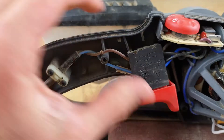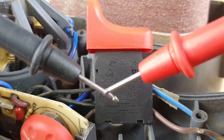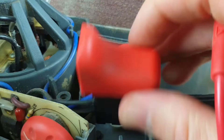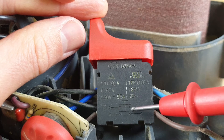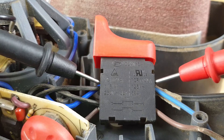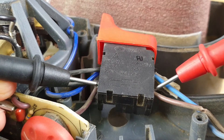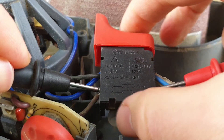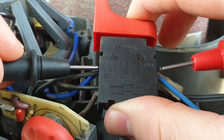Next thing — probably the switch. You will need a multimeter to test this. We're going to do a continuity test across the wires. If you're not familiar: if both probes are electrically connected, we should get a beeping sound. I'm going to lock this switch down so that way hopefully the plunger, which connects each set of wires, should be connecting the circuit on each side. We'll go top wires first. I don't hear anything. Try the bottom. Don't hear anything on the bottom either. This could be a failure of the locking mechanism. Good continuity on the bottom if we don't lock it.